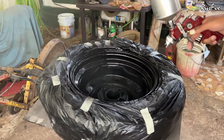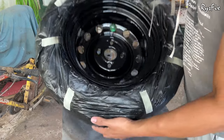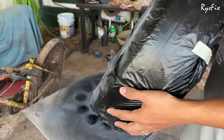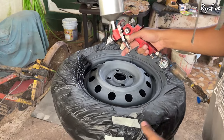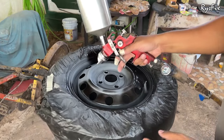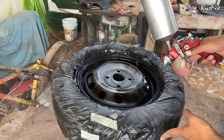I've applied the paint on the back side of the rim first. The advantage of painting the rim with the tire on is that you can turn the rim mid-paint job — the tire is fatter than the rim so it touches the surface instead of the rim, allowing you to paint the other side without issue. I'll be applying two coats. This is a single stage paint so no clear coat is needed — it hardens directly and protects the rim.